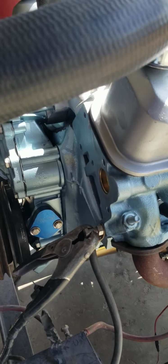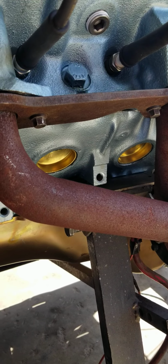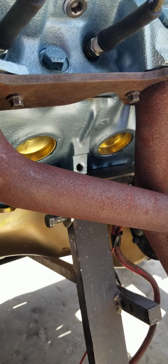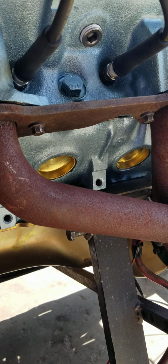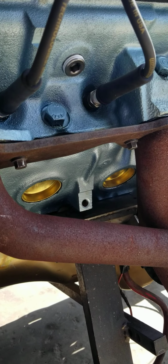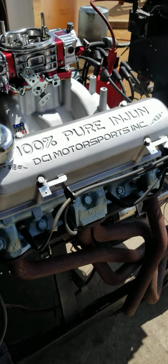Another thing we do too is we use a brass freeze plug in our engine blocks. We used to use steel, and like the old saying goes, you get what you pay for. We found out that the steel plugs start to rust out at about 2-3 years, and customers complain about coolant leaks. So we quit using those and put brass in now.